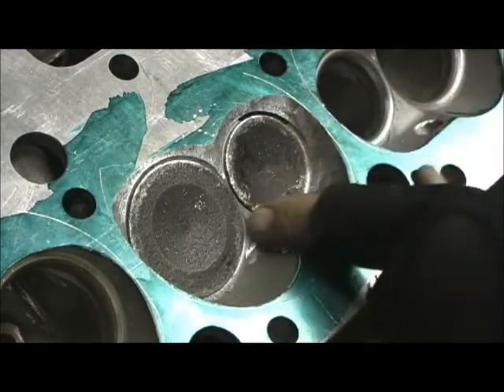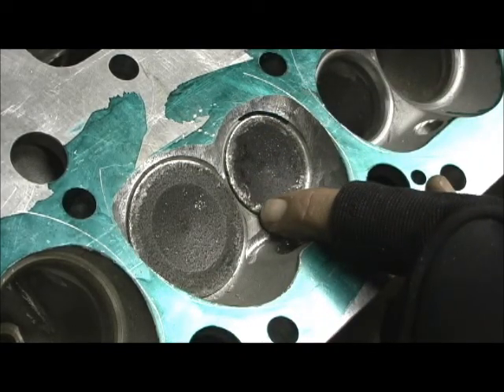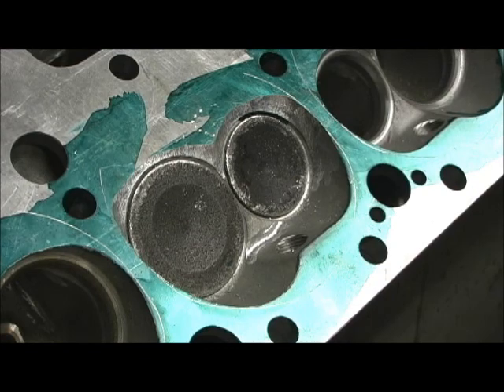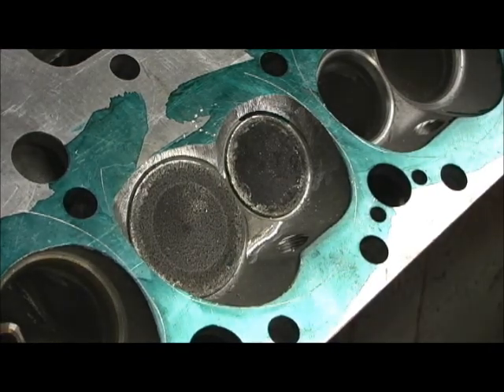This is a high lift airflow side here. Now I'm fixing to switch cutters and go to a different shape egg for this and this. So let's switch carbides to some other shape that we need.